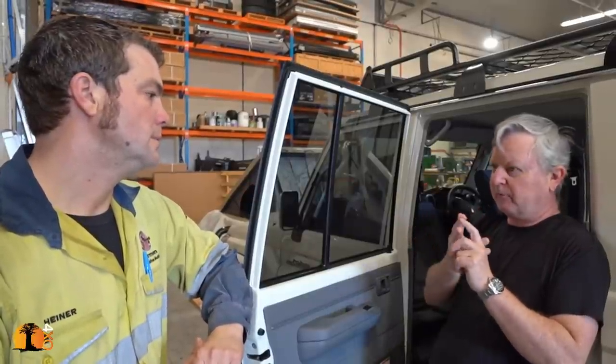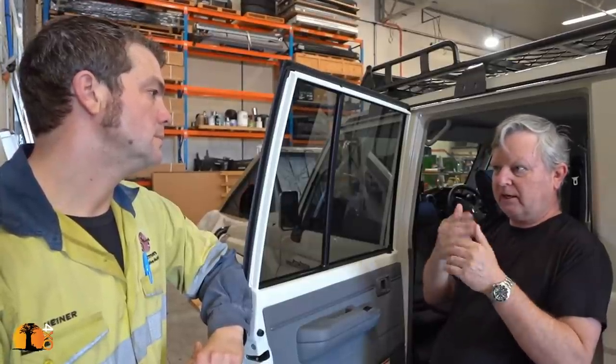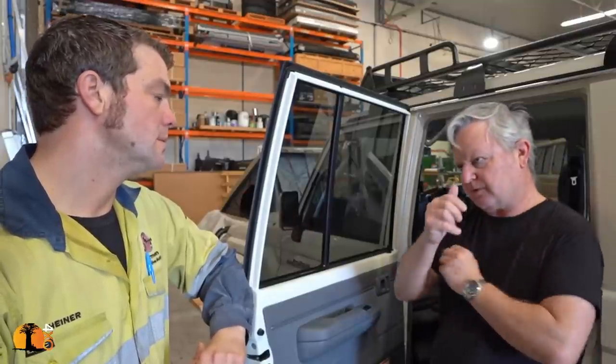And I also have to think about how hot the charger might get. So if it's in an enclosed space, if it gets too warm, it generally thinks the whole system is overheating, so it actually pulls current back. And we don't want that. That's correct, yes. What do you suggest with this vehicle?